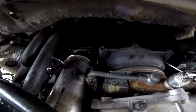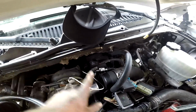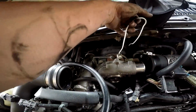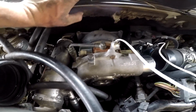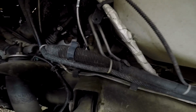The downpipe's out. I pulled it out through the bottom, fairly easy, leaving the glow plug module relay back in. I already undid the vane position sensor, and we just have to do the 2 oil drain lines and the uppipe for the driver's side, which, like I said earlier, is the 12-point, 12 millimeter wrench or socket.